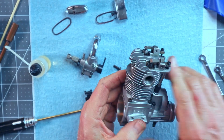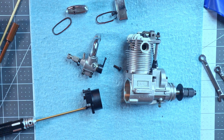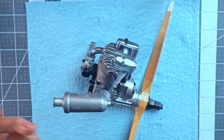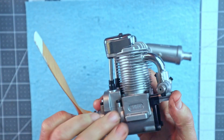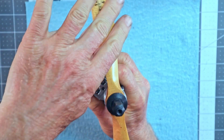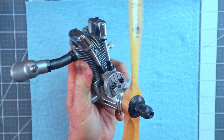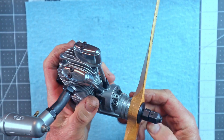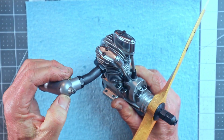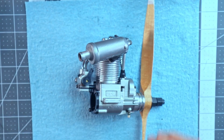I think what this engine needs is just to be put on the stand and run, with the valve lash properly set. So that's some quick troubleshooting of a four-stroke engine that had no compression. Off camera I set the valve lash, and here is this beautiful spectacular Saito FA-82 engine with a prop on it. It's got massive compression now — trust me, it has really really good compression. What I showed you earlier was exactly that: the valve lash just wasn't set. Now with the valve lash set this engine looks basically brand new.